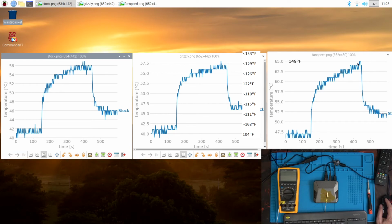But I'm happy now that I've got it all in there. I don't need to open it up again, and I'm leaving it set to 67 degrees Celsius before the fan kicks in at 100%. Nothing before that, because it never reaches it. And as I say, I've played around with this before, and this is what gave me the whole idea to try out Thermal Grizzly and everything like that, because I'd already had the fan set at 67 degrees Celsius at 100% fan speed and never had the fan come on when I was playing emulation, say like an Amiga emulator, and playing for half an hour.